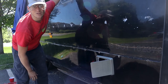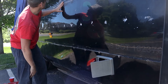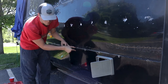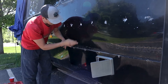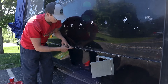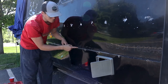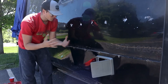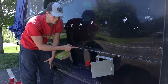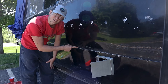Here's what I was talking about on the outside — this big panel from the top comes down and overlaps the lower piece by about two inches. There are big bolts securing this top piece into that piece of wood on the inside and going through the fiberglass, and then there are smaller bolts securing this overlapping piece to the other piece coming down. I think if I take out these bolts to get them out of our way, the wall is going to flop just like the other side — which basically has no bolts attached and there are no repercussions. These are going to come out and get replaced anyways — they're rusted and we're going to screw them into steel this time instead of wood. Let's take them out and fingers crossed nothing bad happens.